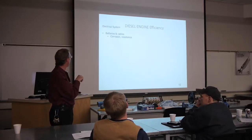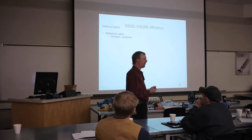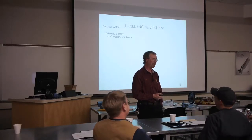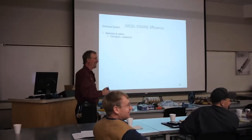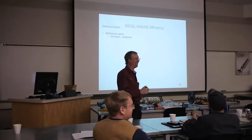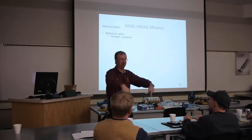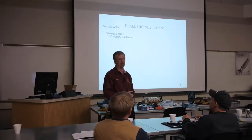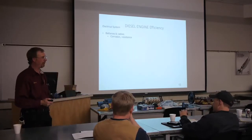Another thing, make sure that these batteries are clamped down, okay? Vibration is the number one killer of batteries. When I talk about a clamp, I'm not talking about a bungee strap, which you've probably all seen with your producers. And a weak one of that. Just kind of hanging out along for the ride. Now, I'm talking about a metal cover on top with two metal stakes down the side that have an adjusting nut to tighten them down. That is a battery hold down clamp, okay? Get rid of that vibration as best you can. We want to look at these components.